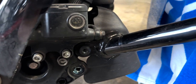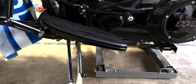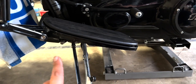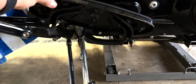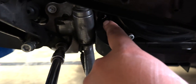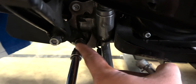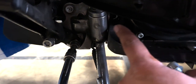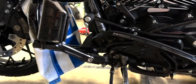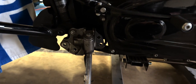Over here taking off this side floorboard — two of these screws actually screw into where the kickstand goes in. There's one up here I already took out, and I'm working on this one. As you can see, this hole is where the jiffy stand goes, so you do need to either put this bike in a wheel chock or put it on a center stand to do this.